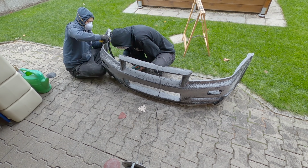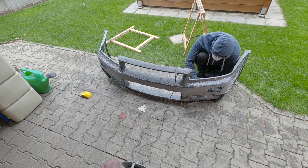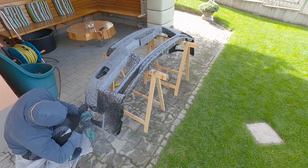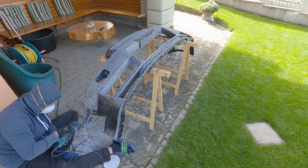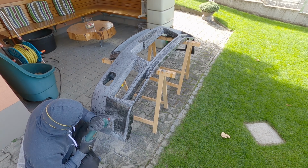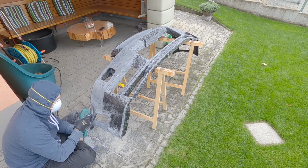After sanding the bumper down and fixing a few spots that I sanded too far, I coated the bumper with a clear filler that I could just apply in my regular spray gun. It does look pretty nice now, but the last step will be sanding the bumper in a finer grit like 600 and giving it a few good coats of clear paint.